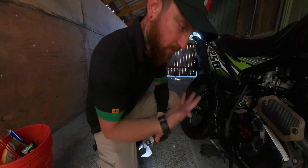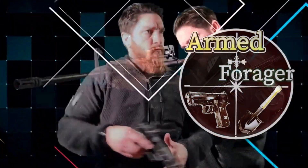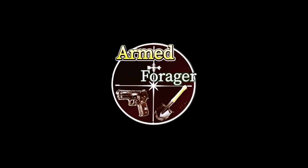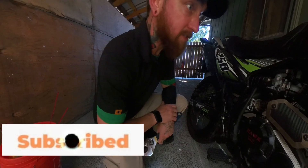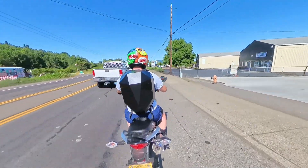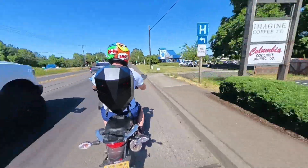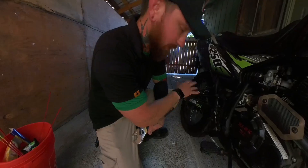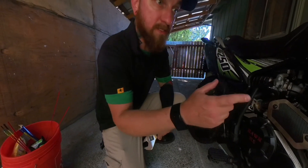Welcome back to the Armed Forager. This is going to be an update on what this bike looks like after a thousand miles. A few things I noticed right away: I did do a lot of tightening and put some Loctite on a lot of these bolts. The one I did miss was the passenger footpeg here, and consequently it fell off at some point — I didn't even notice it.